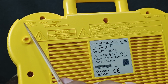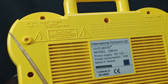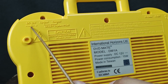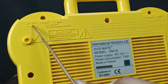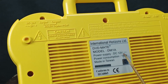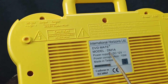This unit requires 12 volts DC, but the current requirement is not specified — that is very important. The polarity is: the outside diameter of your DC plug is negative, and the inner center hole is positive. The specifications show DC 12 volts and a power consumption of 15 watts, so now we have the wattage for this unit.